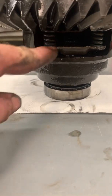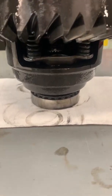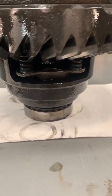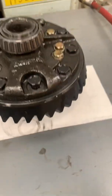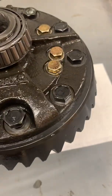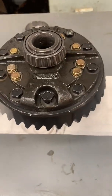There they are - springs and plates. Make sure they don't go anywhere. They're under tension from tightening it down, though it's not as much as you would think. Then I can pull out the side gears, the pinion gears, the side gears, and get the cones out that I need to get to. I'll split it all down and spread it all out and show you.